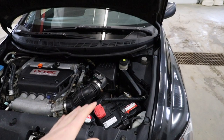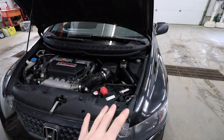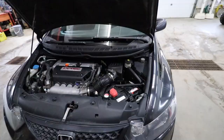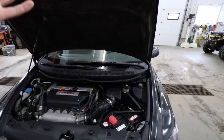The stock intake is so bulky and takes up so much space — I just want to have a big turbski sitting right there. The first thing we're taking apart to give us more space in this already crammed 8th gen engine bay is the intake. I'm also going to get the wiper cowl taken off for more arm space. Taking the intake out first gives us a lot more room to reach the exhaust manifold from the back.